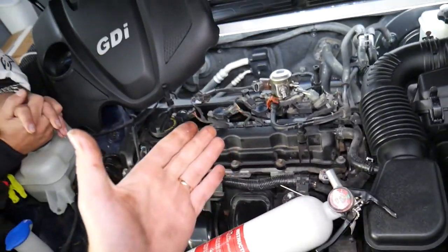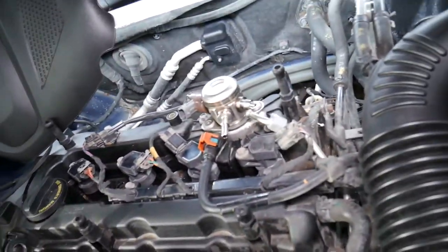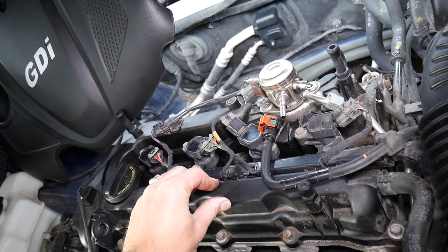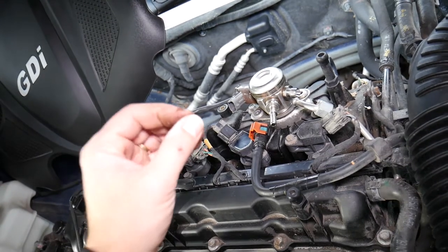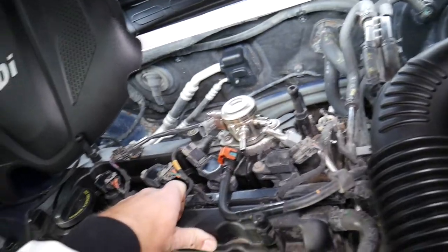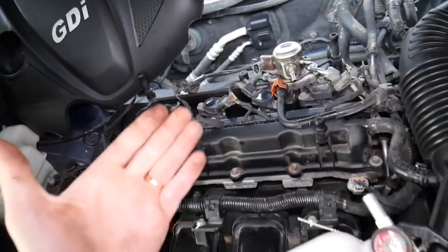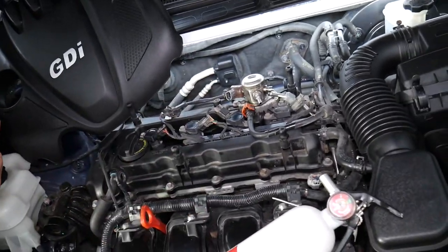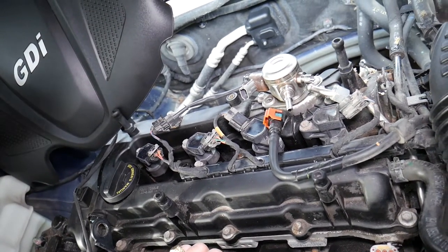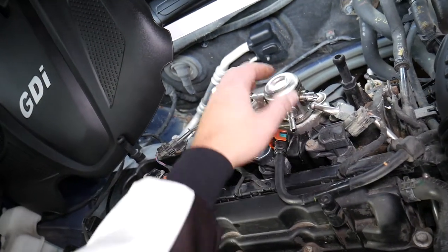You've probably noticed that direct fuel injection engines are a little bit louder, and you wonder why — it's due to the fact that direct fuel injection creates quite a bit of pressure, so it sounds a little bit like a diesel engine. But that's different from an excessive noise or rattle. Many people go to the dealerships and the mechanic tells them it's just the direct fuel injection and it's fine. In some cases it's not — there is a difference between normal knocking sound from the pump and excessive knocking noise.